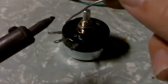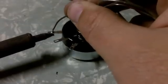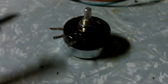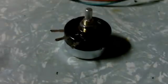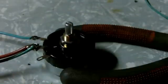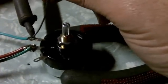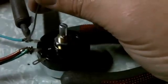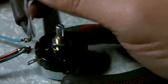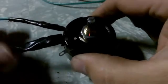We've got our soldering iron nice and hot, so I'll just give it a little test. There we go. Just tin our tag and we'll tin this one as well. So what I'll do is get our wires and we'll attach them. That one's much better. So there's our little trim pot, all soldered, ready to go. A bit of insulation tape there to protect the joins.